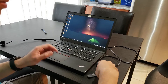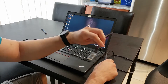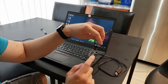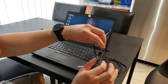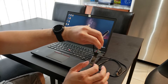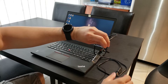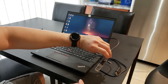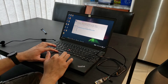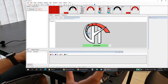To start programming, you've already hooked up the wires to the FTDI cable — you need some sort of FTDI USB cable to be able to program these. What we're going to do is set it into what they call AT mode. I don't know what that stands for, but it's supposed to go into AT mode and blink slowly — that's when you're in programming mode. We're going to do all the programming through Honda Tuning Suite, which has a section where you can program these Bluetooth modules, including the HC-05 and HC-06.